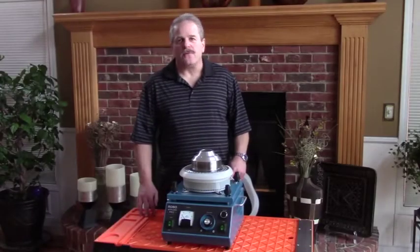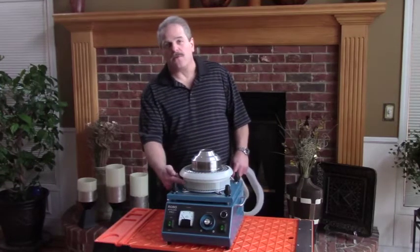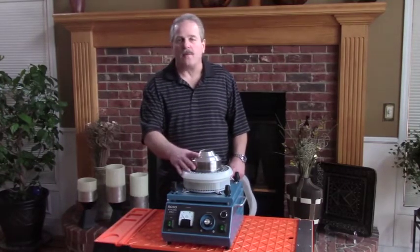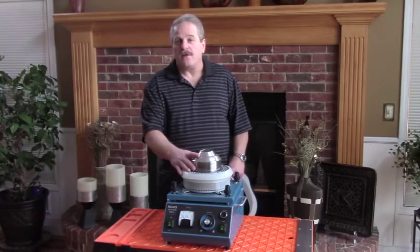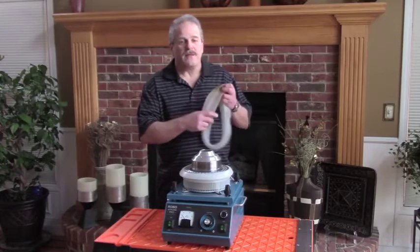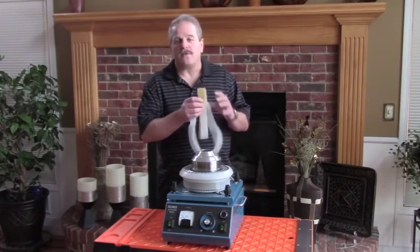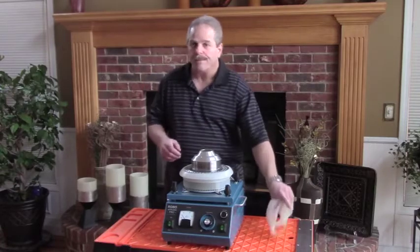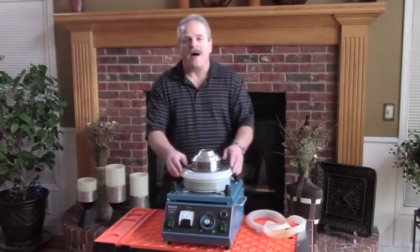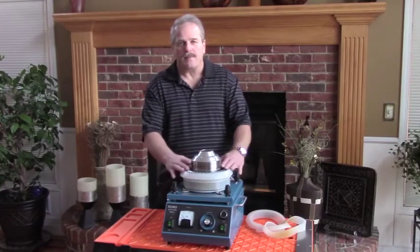The next step is to install the silicone sealing collar and the silicone airflow restriction ring on the stator of the Robo JetFloss. The unit ships with 1 collar and 2 of the air restriction rings. These are silicone, they are flexible and stretch quite easily. However, do not stretch them too far, they can break. The purpose of the collar on top is to seal the floss pan and simply prevent sugar from falling onto the base of the unit. That'll be our next step.